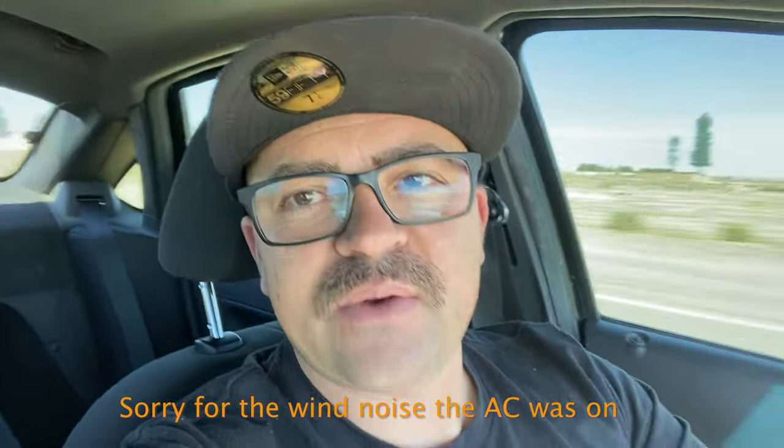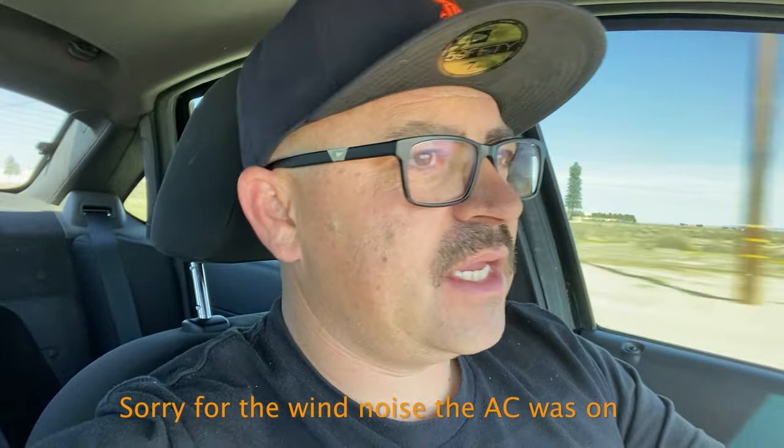So the reason I didn't go any more than 1 inch, I don't know if I said this earlier in the video, but it's because I didn't want to get the wheel so far back that it doesn't look like it's in the center of the wheel well. And the wheelhouse is curved like the opening in the fender. And if the wheel's scooted too far back, when the suspension articulates, I don't want it to be rubbing the wheelhouse. You know, the wheelhouse is real big in the front for a reason, because that's where the axle's supposed to be. So I'm hoping 1 inch works.